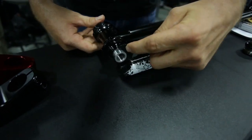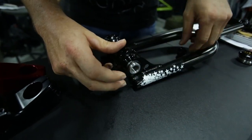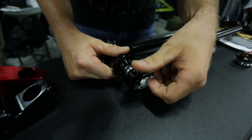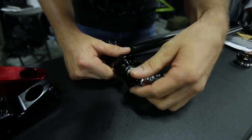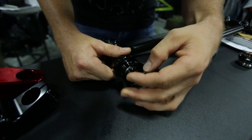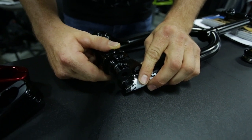So it goes in here — there's a groove set up right there where this washer goes into that. And when you tighten this bolt down, it locks the hub into place. So it's like a slotted dropout, but at the same time it's like a closed dropout. So now it's impossible to pull the hub out of the dropout.